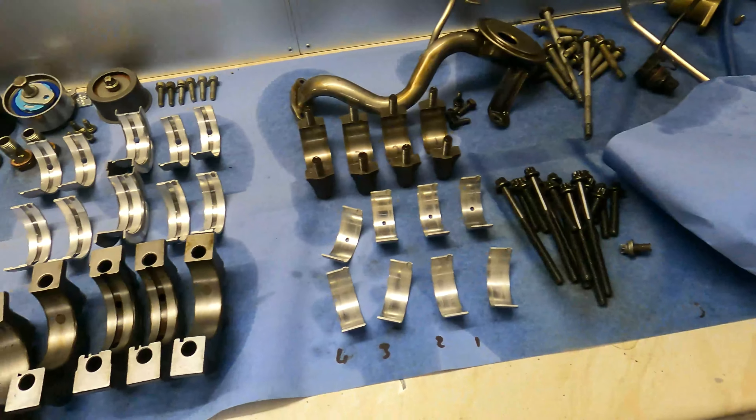I said we're good for launch but I've just noticed down here there's a drip coming from this metal pipe. I noticed when I went to put this one on that it was bent round — it must have got caught up somewhere — and when I bent it back it looks like it's put a little crack in there. I have got another one off the other car but for now I'm just going to bypass this metal one that's leaking and go straight from here all the way around into there, to get us up and running until I get the other pipe.